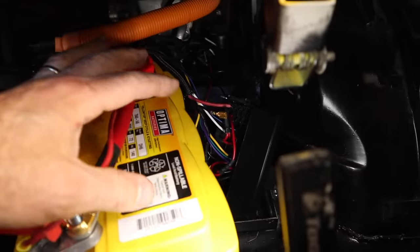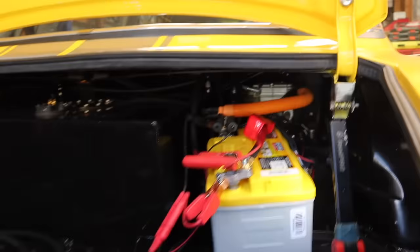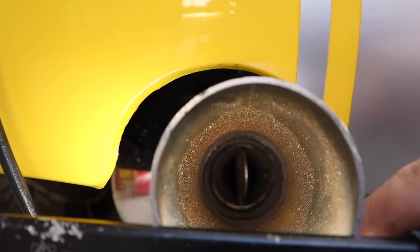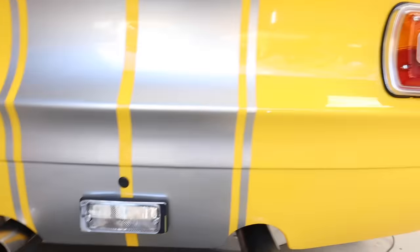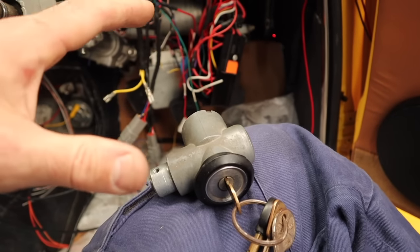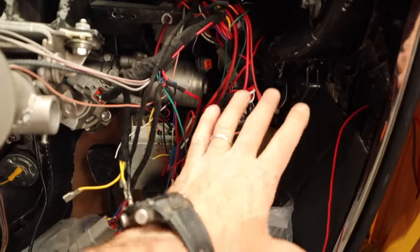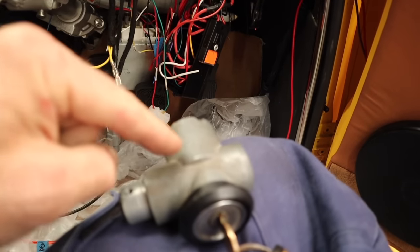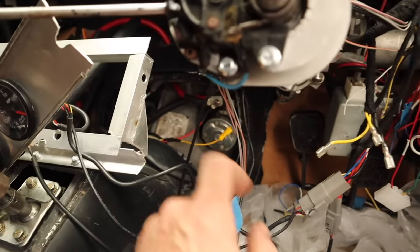I've been rewiring the whole back end of the car. I've rewired my relay so it should be negatively switched, not positively switched. I also went under the car and played around with the valves — you can see there's a valve there — making sure the exhaust is open so when I start the car the exhaust will be open, not closed. Now, the ignition switch wasn't working last week. The PDM I have — a little tiny motorbike PDM unit — actually needs to be negatively switched. I converted it for that, but what I didn't switch was the wire going straight to the starter motor — the starter motor needs to be positively switched.